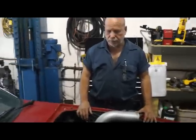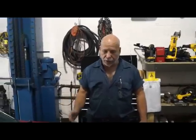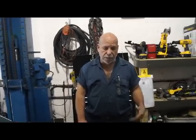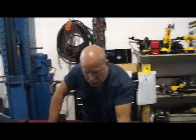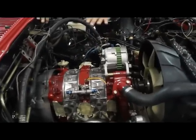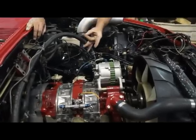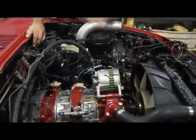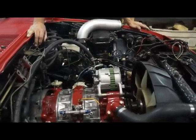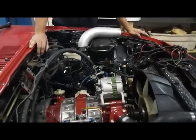Very simple. Oh, I forgot to mention one thing. You have to upgrade the fuel pump, because these cars came carbureted and we're putting in an injected motor. If it were a non-turbo engine and you ran either a Holley or a Weber or an over-the-top, like the old Racing Dellorto kits, which you can get the manifolds, but the Dellortos don't exist anymore, you can put a Weber, an SK, a Mikuni, whatever side draft you want, it would come over the top. The factory fuel pump would be more than sufficient. So it's straightforward. There's very, very little to think about.